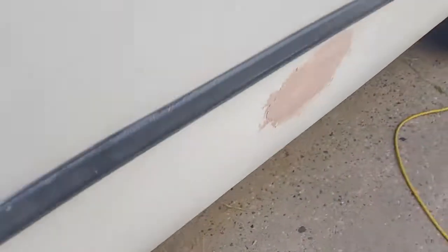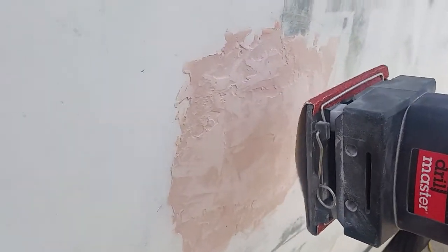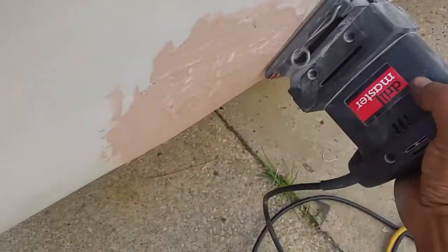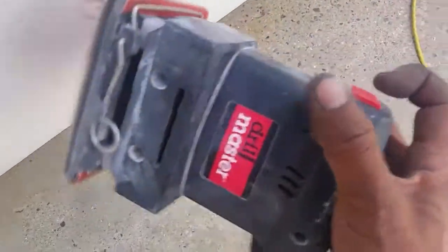Today I'm going to show you how to sand out the bumper. First of all, you turn on this and sand it down soft and nice, around the corner — all of it, around the corner. The reason I'm saying that is because you want to get the sticky residue on the bondo out first, and after that you sand hard and smooth. Going around the corner is very important.